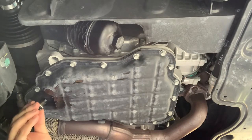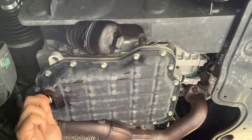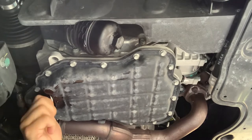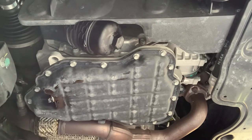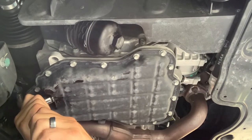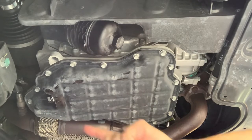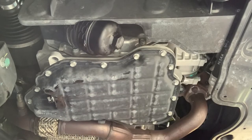For the drain plug — it's still dripping a little oil, but no big deal. We'll do this by hand first — very important so we don't cross-thread the bolt. Tighten that up as much as we can, then use our 17-millimeter socket to snug it up. I'll come back with the torque wrench in a few minutes and get that to spec as well as the oil filter housing.